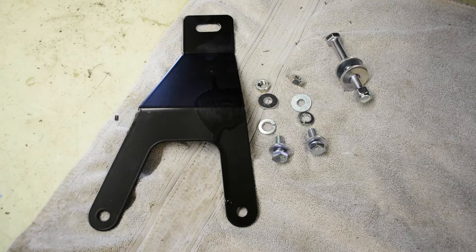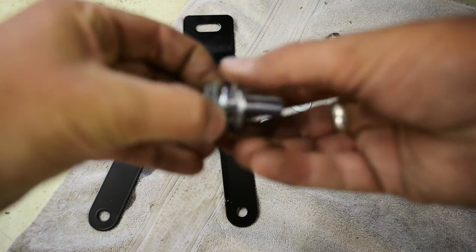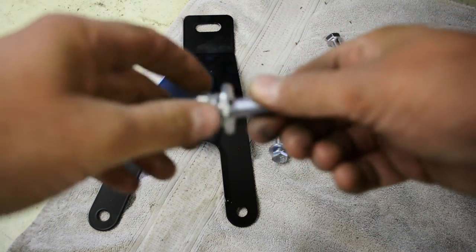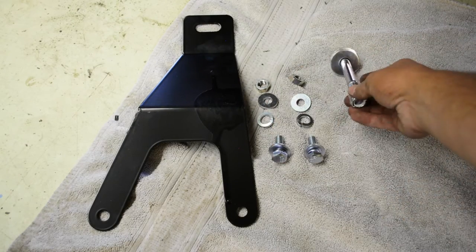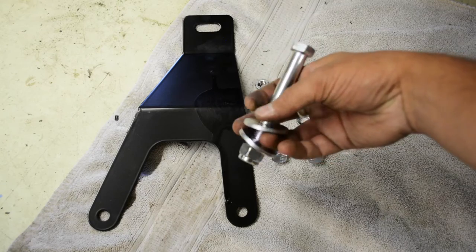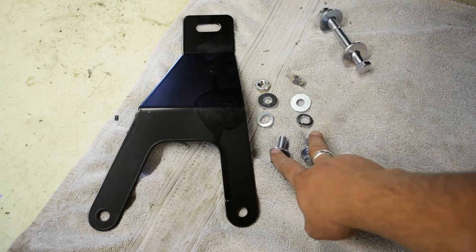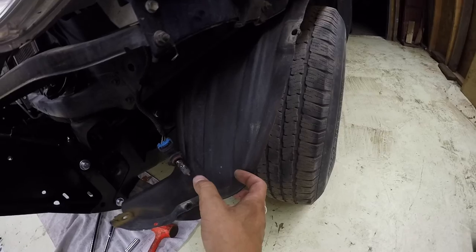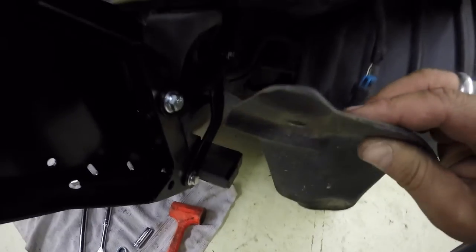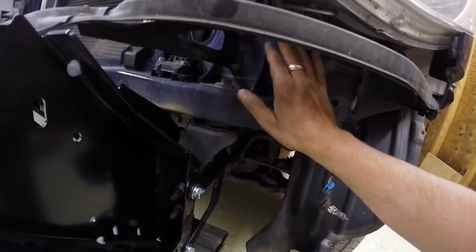Okay, so this is what you'll need. There's a bunch of bolts that come with the washer and the locking washer already on them. So you use two of those, four more washers and bolts, and then the back, this longer 4-inch. And once you get it on, tighten up your front bolts first and then tighten up your back bolt. Wheel well fender, use this hole to bend it up, zip tie it up here.